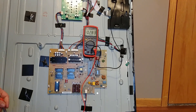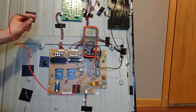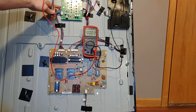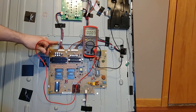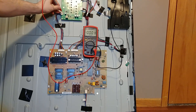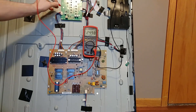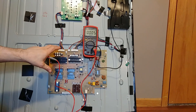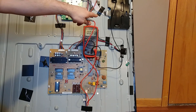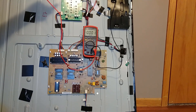I've spun the TV around and it's still in its backlight-off but TV-on state. I'm going to start with the power supply for the backlighting — this is the backlight driver board. It uses 24 volts to work with the LEDs, and the power supply is still on and fine, so I'm not concerned about it. Since the image is still there, the T-con is only responsible for the image, so I'm not going to worry about the T-con either.